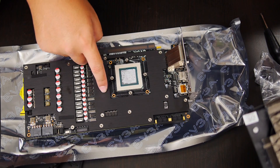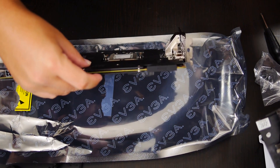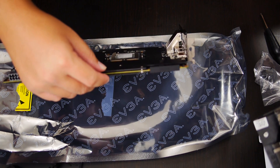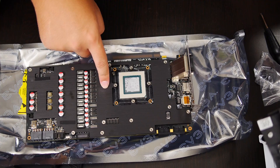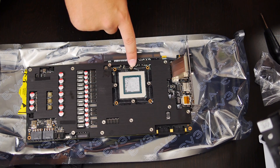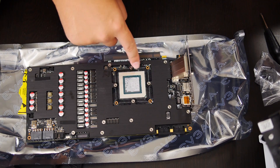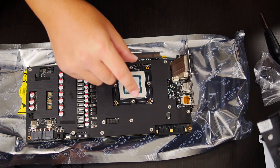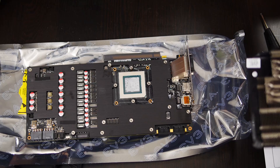This is why this video is a little bit different — instead of just installing it onto a bare PCB, it has all this extra space it also needs to install on top of. Along with this heat spreader, these little secure points will actually get in the way of the all-in-one cooler. So we're going to have to install a copper shim on top of this in order to give it the space needed to have contact between the chip and the cooler.